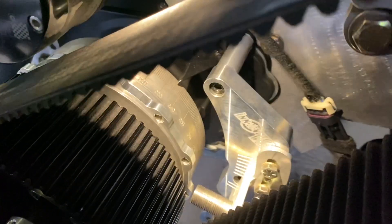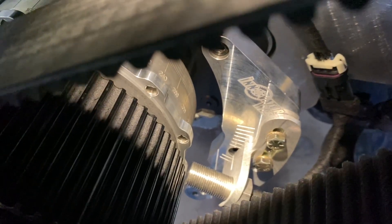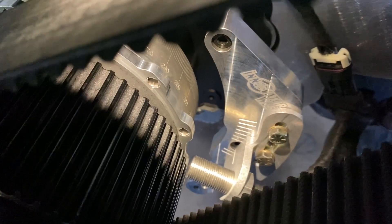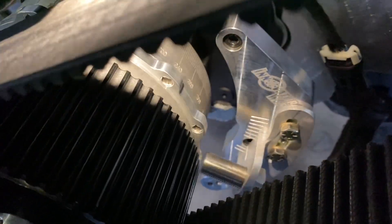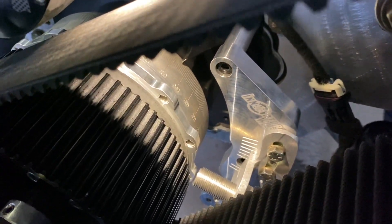This is going to work pretty well, but he also had to get a different pickup because Holley requires a square wave and a normal sensor will not work. So that's the new Holley sensor — it'll produce a square wave for it to work. It's all set up.